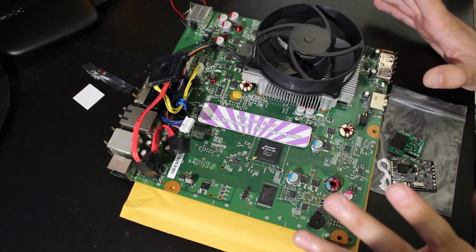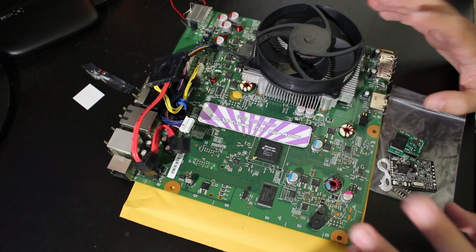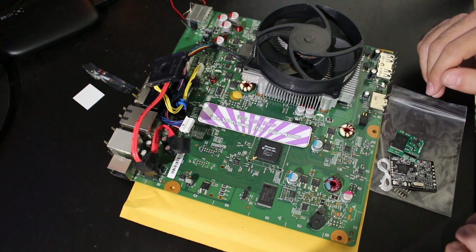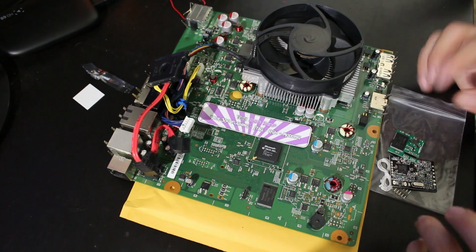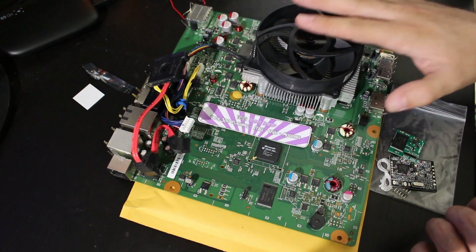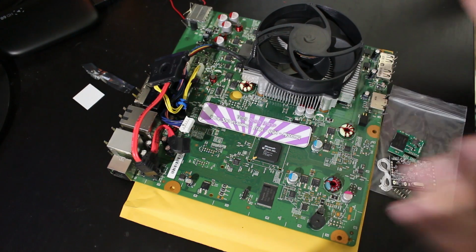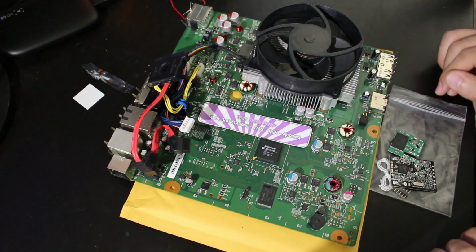However, one prerequisite I would recommend before you take this thing apart is to actually update your system to the latest firmware that you can. So I myself, for example, the link that I'm going to have down below in the description, at least at this moment in time, is for a JRunner build, which uses dashboard 17511. I've actually already updated this console to 17511, so it's going to make the process a little bit easier, and for sure everything will work on there. But go ahead and update it to that, and then you'll be able to continue the exploit here.